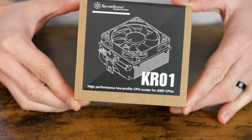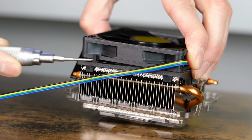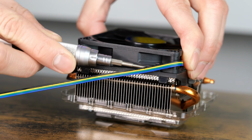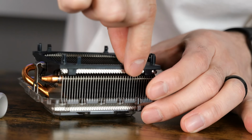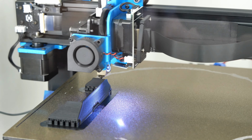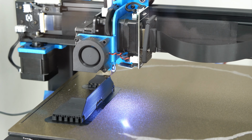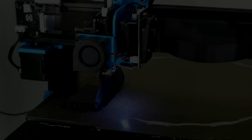As a last-ditch effort with this design, I got a new CPU cooler that has cooling fins parallel to the case fans and designed a new fan shroud for it. I had hoped the fan shroud could stop recirculated hot air from re-entering the heatsink. I saw some improvement with the use of the shroud design, but all it did was delay thermal throttling while using the AMD Ryzen 5700G.